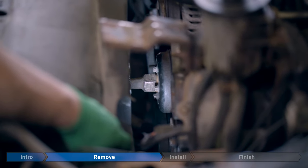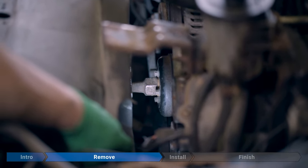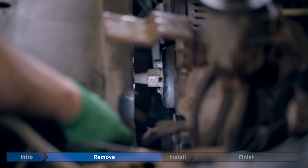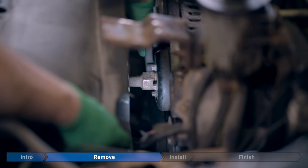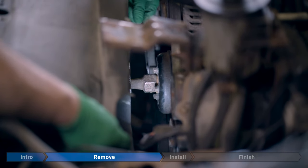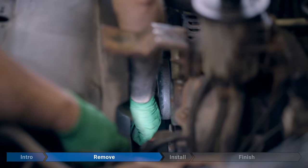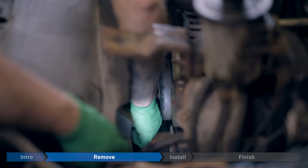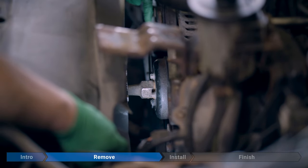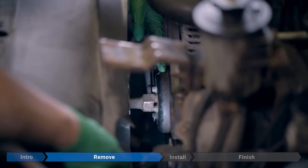First we're going to fix the water pump pulley in place. There isn't going to be any specific procedure — it all depends on what kind of tool you're using. The core of it is we just don't want this pulley to turn while we're breaking the torque. If you're using an ad-lib tool like ours, slide it right over one of the bolts — in this case the one on the bottom — then rest it on the bottom of the next bolt over, and brace it on the belt tensioner. Once we get all this stuff out of the way, I'll show you what we're doing.